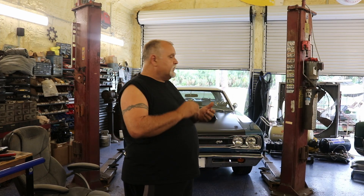The test drive went pretty good. Had to do a little bit more tweaking — it was wanting to stumble on takeoff but got that cleaned up. Everything's doing good on it. Pretty much got my exhaust leak fixed, got my starting problem fixed — that's with the battery, new wiring, battery box, battery, everything. It's a new starter. And we got our flooding out problem where we're just getting too much gas fixed. We're completely programmable now.